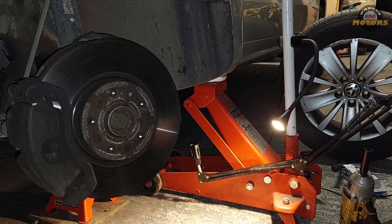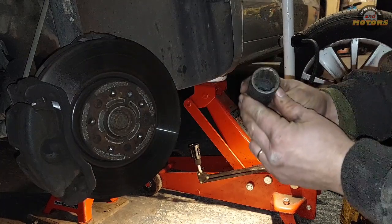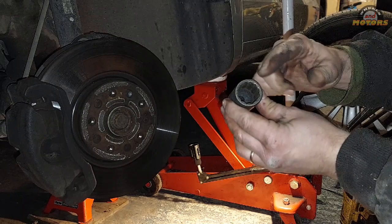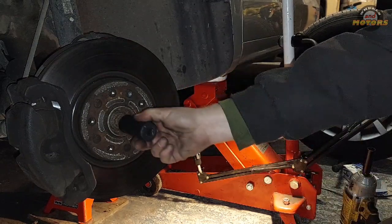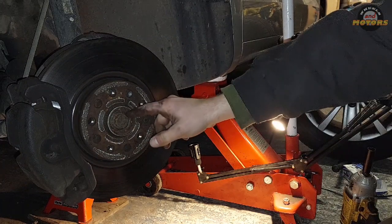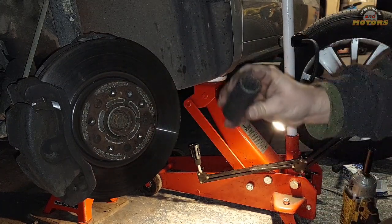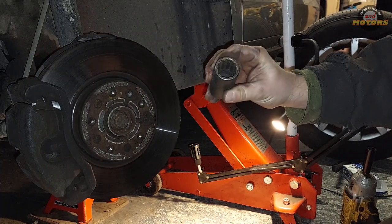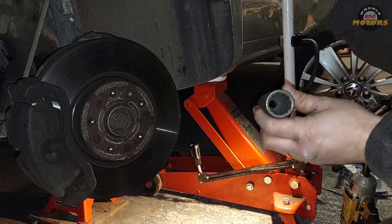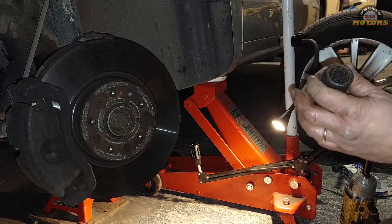Now let's talk about this bolt in the middle. For that you will need a special socket. If you have the original bolt, it's a 24mm triple square, like a 12-sided socket. Sometimes if it's a cheaper bolt, it can be hexagon, and that will probably be a 27mm hexagon. Nevertheless, we have the original good bolt, which is 24mm. Get ready for this. If you don't have this socket, I'll put a link in the description where you can buy this tool or any other tools.